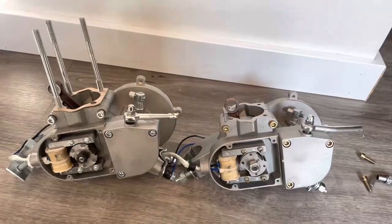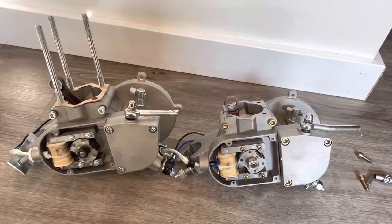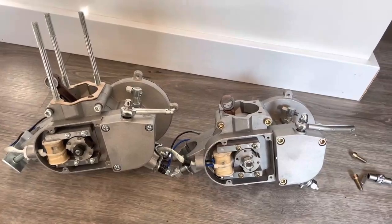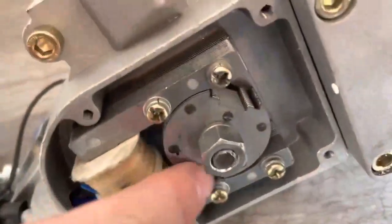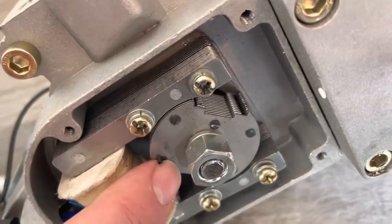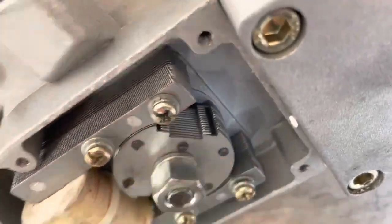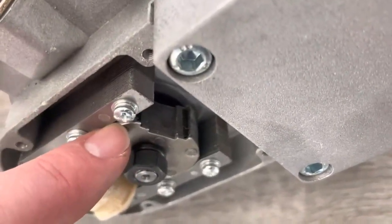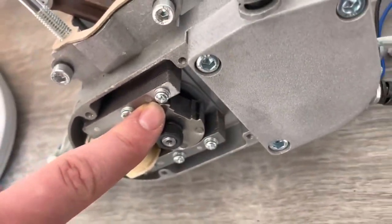Here's a subtle difference some people may not notice: the eBay/Amazon engines use a cheaper-to-manufacture magnet than the Wildcat. These magnets are stamped into little pieces out of sheet metal and hand assembled in China. The eBay/Amazon engine's magnet is comprised of thick layers, however the Wildcat magnet is comprised of many thin layers. This creates a stronger magnetic field, which makes a much stronger spark.